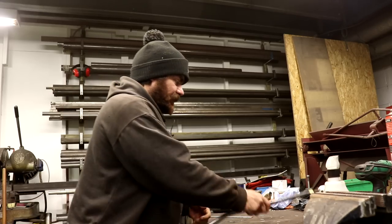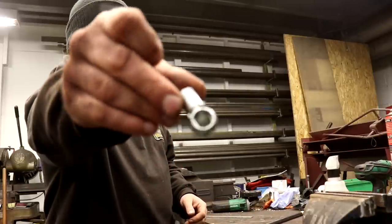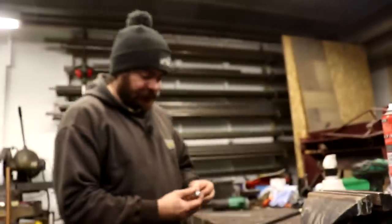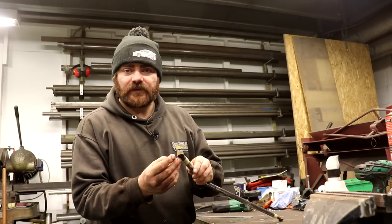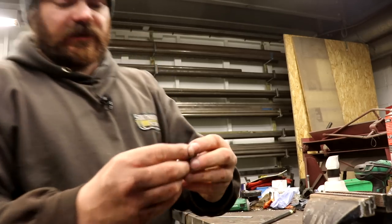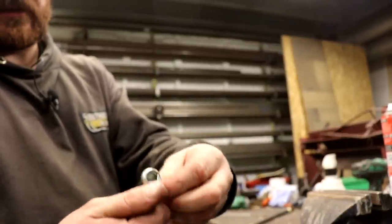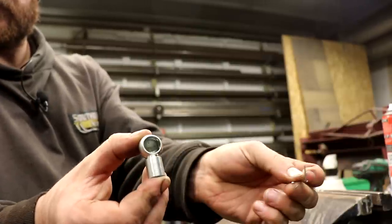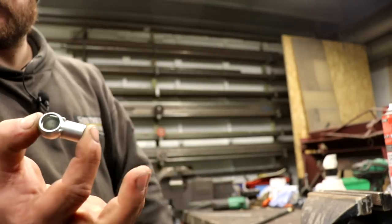To that end, I have bought some of these — it's like a little screw-on ball joint socket thing. I'm going to cut the ends off here and weld these on. There's no rubber bush in these; they're metal inside but they've got a spring retainer. If you've fitted aftermarket boot strut lifters, you'll be familiar with this — that's how they lock on. So they won't wear out either. You just fill them with grease, put that on, done.